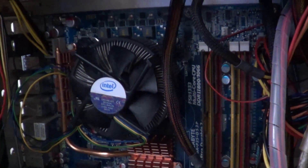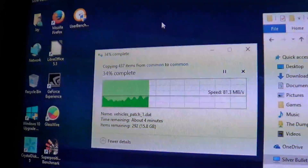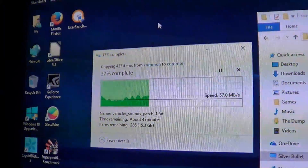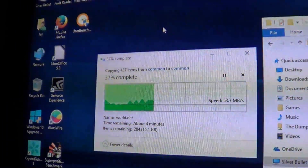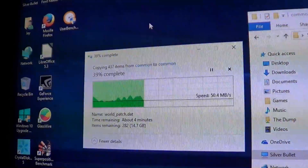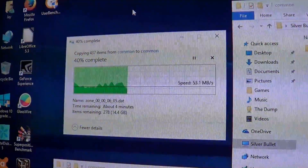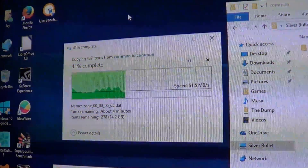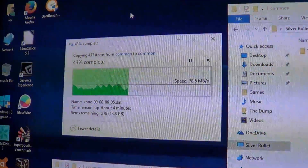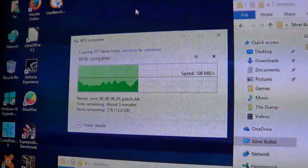Well, the joke's on me — it looks like the answer is not very bottlenecked at all when you go all the way back to a Core 2 Duo, mostly because of new technologies that have become mainstream since then, like SSDs. I do notice some lag with system tasks that would normally grind up the drives on an old mechanical drive system. Now it's the processor that's the bottleneck, so you see 99% CPU usage instead of 99% disk usage in Windows Task Manager. For everyday tasks and light computing, a Core 2 Duo with an SSD could crunch spreadsheets in a business.